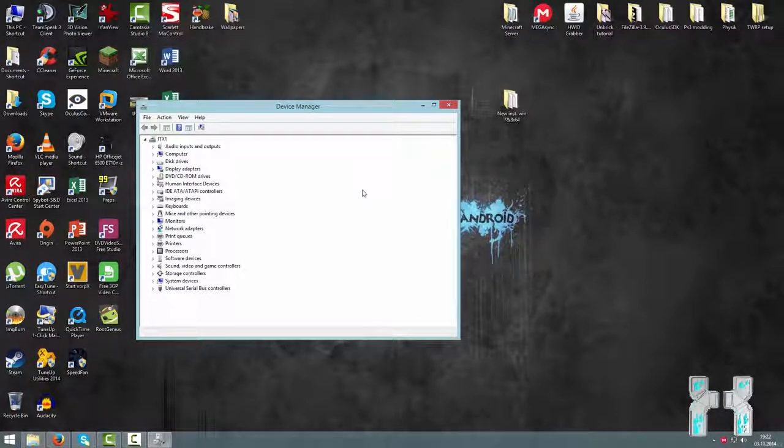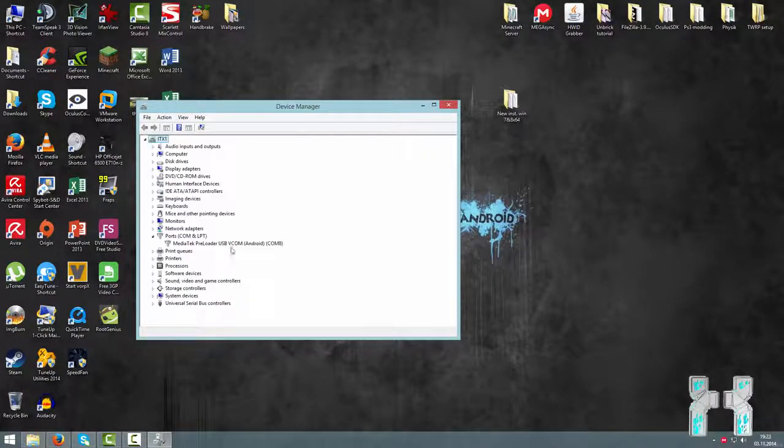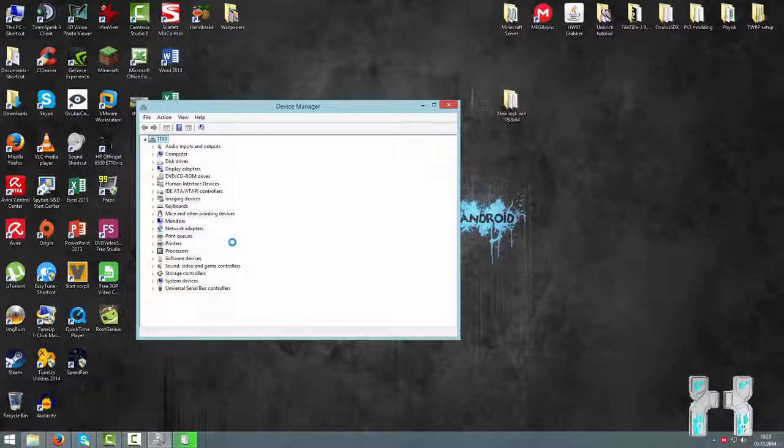Once connected, it should pop up under Ports — that's completely normal. The problem is it reconnects and disconnects repeatedly, which interrupts the flash. But if I press the volume down button, it stops and switches to MTK USB port or VCOM port — that is META mode, which is what we need. If I keep holding the volume button and connect it, I should just get the MTK USB port, and now I can actually flash the smartphone, because the MediaTek USB port stays stable after downloading the preloader.